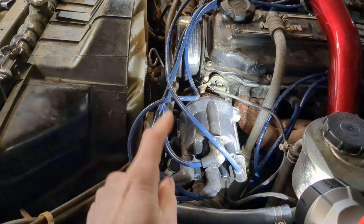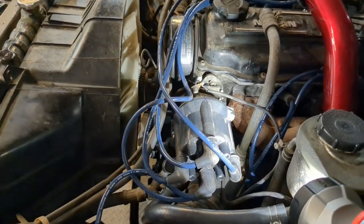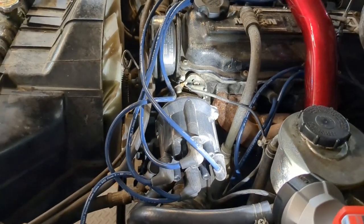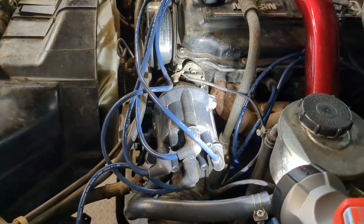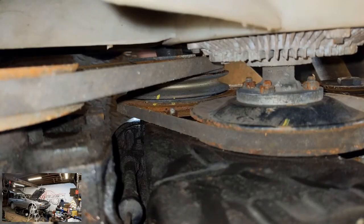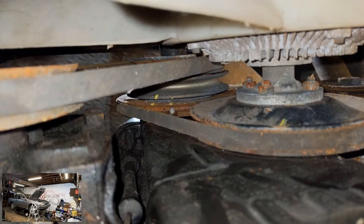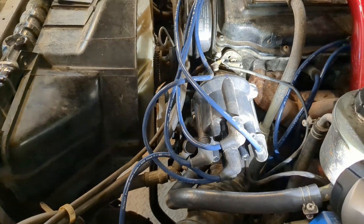It's hard to get these things not 180 degrees out. It's really hard to get them not 180 degrees out when there's 8 spark plugs for 4 cylinders. In fact, I did it twice. I pulled the distributor out, snapped it back in, had everything what I thought was lined up, lined it up to the crank pulley, thought everything was golden, and had nothing. But eventually, we got there.